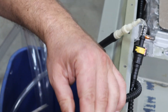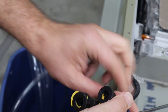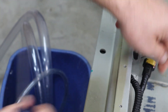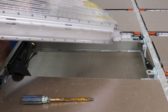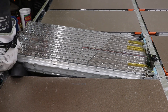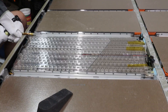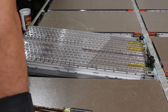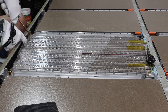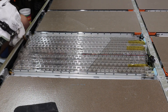Pop our plug back out. Now we know the coolant system is sealed and everything's working right, so that last battery module can go in. It was not always easy to connect the coolant lines. Typically what I did was get the module into place but hold up the outside edge with a rubber doorstop, just enough to get the coolant lines connected. Sometimes I'd have to get one coolant line connected, put the battery module down the rest of the way, then connect the second one. It just depended. But take your time and make sure you get them connected properly.